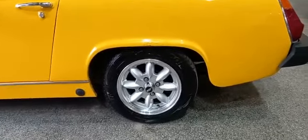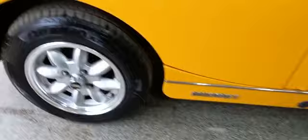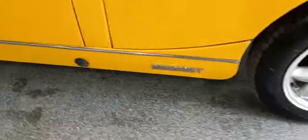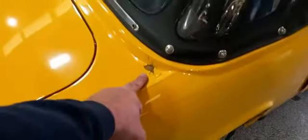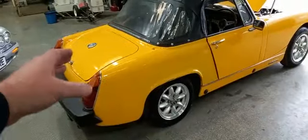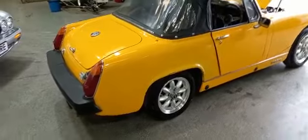And on the outside, she's just going to want a little bit of work. We've got a rear arch there — the usual area, just on the bottom of that pillar there. They always go there, don't they? But in actual fact, it's not too bad at all. Just starting on the driver's side pillar there. If it wasn't for that, you'd get away with just doing both rear arches. It's going to want the rear tub section really, and those bottom pillars just addressing. But that's not the end of the earth — you'll soon tackle that, I'm sure.